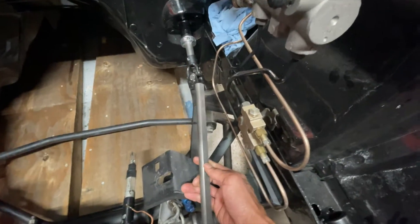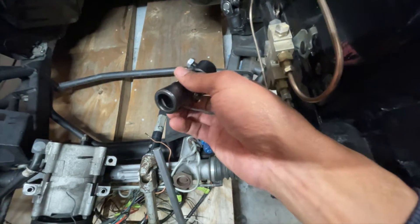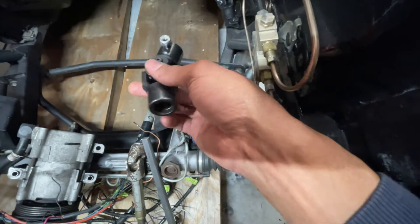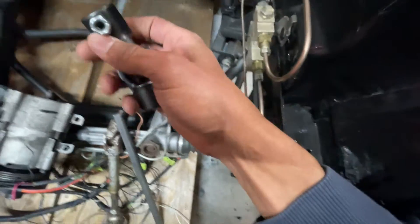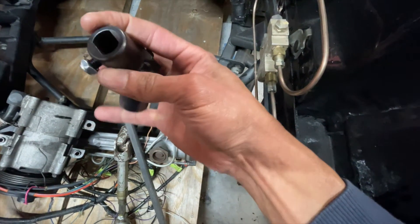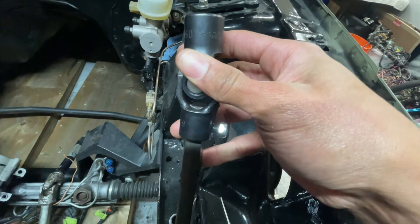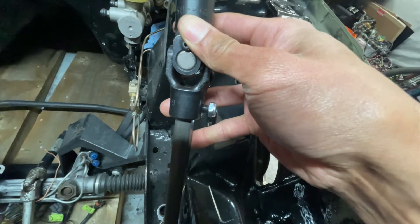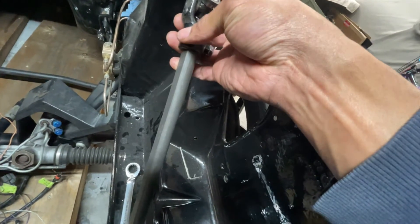From there you put your shaft on, and that's where you need your second U-joint that goes to your steering rack. Remember, from Speedway Motors — if you have a stock heavy power-assisted steering rack or OEM SN95 rack, it'll have that fitting which goes to the steering rack, and the other end goes to your solid shaft. This one has a little Allen key set screw with a lock nut. Be careful because this one can over-penetrate — if you go too far in, you lose mobility of your U-joint. You could actually weld this one if you wanted, since it doesn't need to come back off. Maximum Motorsports does tack their U-joints to the shaft.